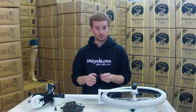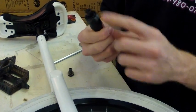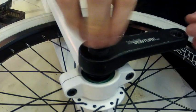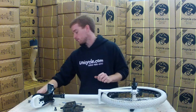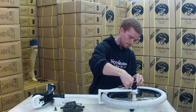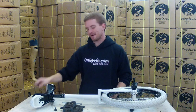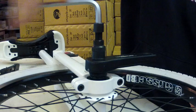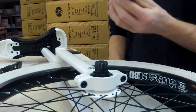This does both, so for ISIS you need to just wind the little thing out, and that threads into the crank like that. You have to make sure when you're doing this that the crank extractor is tight — take a spanner and just give that a little nip. You don't need to go massively over the top with that. Then back with the allen key, wind that in and the crank should slowly come off, just like that.